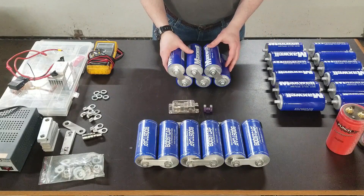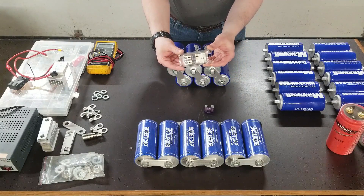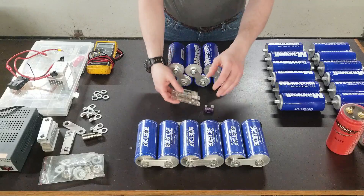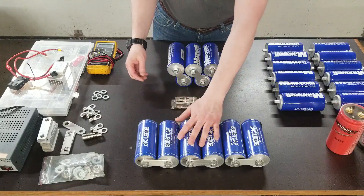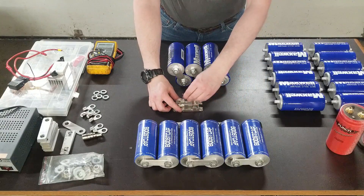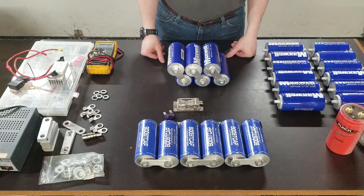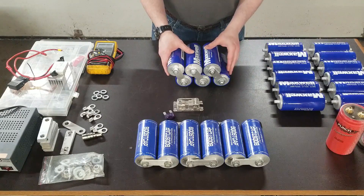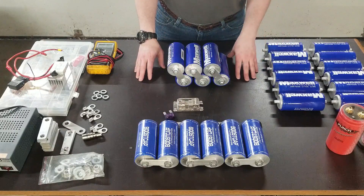Pop into your cargo area, pull the maxi fuse, and disconnect these from the system. A maxi fuse holder with two inputs on one side and two on the other lets you run your capacitor into the fuse block and then from the fuse block to the amplifier — the cap bank and amplifier are run in parallel. Always pull this out before getting your car serviced, and make sure your ultracapacitor bank is within a volt or two of the vehicle battery before reconnecting.